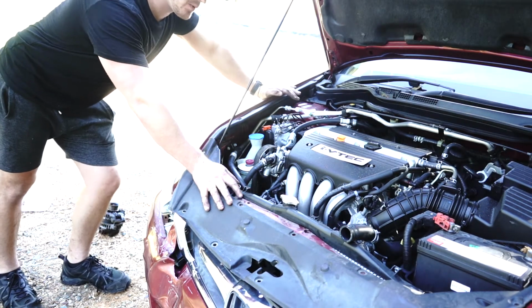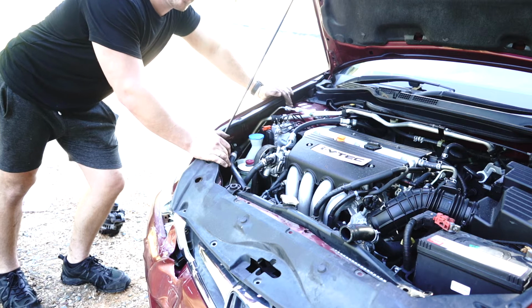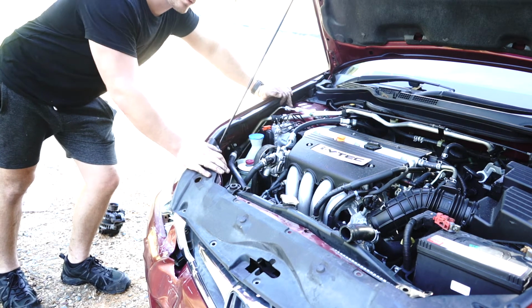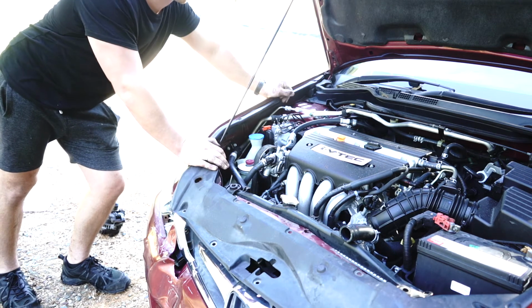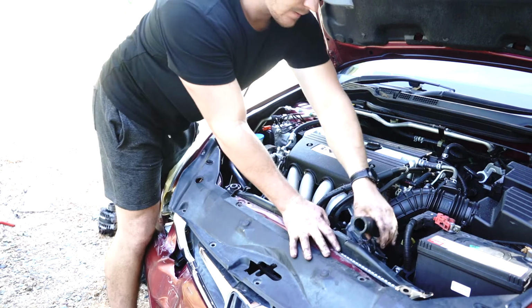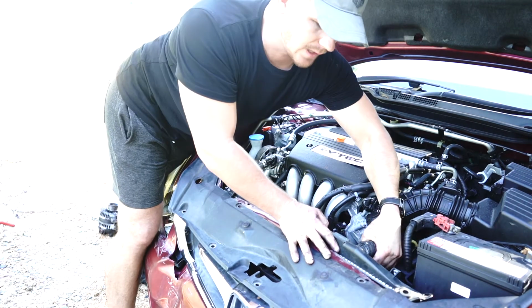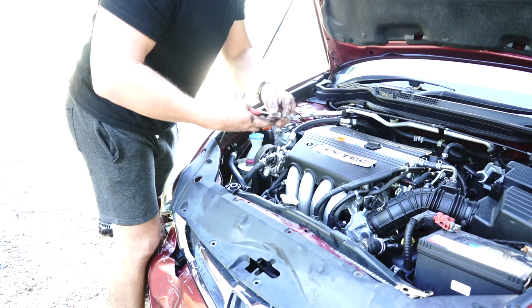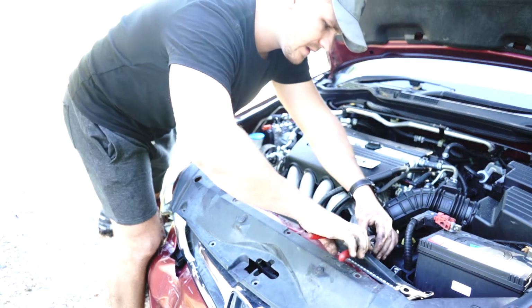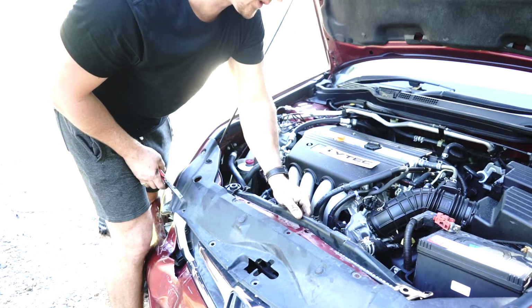Okay, so now that we've finished the alternator job, we obviously put our fan shroud back into the spot. We plug the 2 plugs on each side. We put our front radiator hose back on like this, coming from the bottom usually. Kind of just want to weasel it on like that. Bring it forward like that, squeezing it, and then allowing it to take pressure on that radiator.